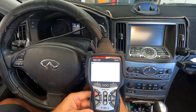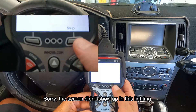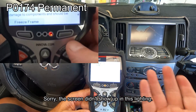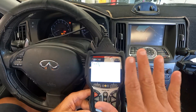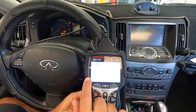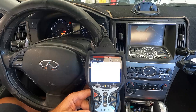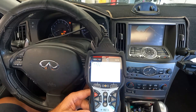I'm just going to turn the ignition on by pressing the button twice. Okay, says we've got a P0174 permanent fuel system lean bank two. Now he said he was cleaning out the throttle body — the little butterfly valves — and he pushed on the little electronic throttle body and he's thinking that maybe that stuck. The P0174 is usually just a lean code, meaning that our air to fuel ratio is a little off, or it might mean we've got a little too much air coming in on that side of the engine. So it could be a vacuum leak or something like that.